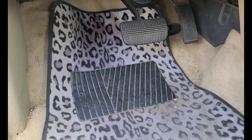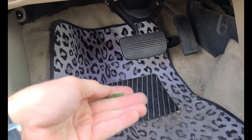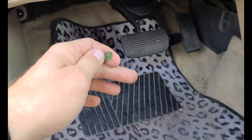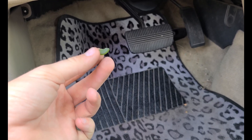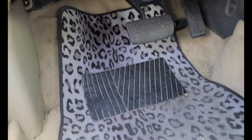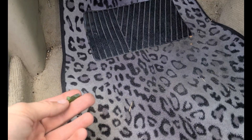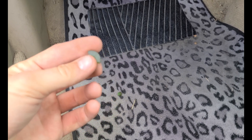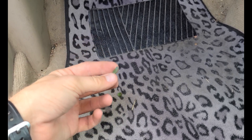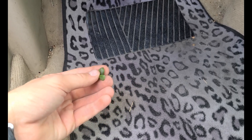Right after I finished the testing procedures for the accelerator pedal circuit, I found these on the floor. This is going to be from our throttle stop — or our brake stop. This definitely would explain, if it came from the throttle stop, why our pedal-at-rest numbers were lower than they should have been. I'm going to see if I have something that can go up in that hole. This is actually a pretty common thing that goes bad, so let me check and put something in there — I bet our readings will be where they're supposed to be.